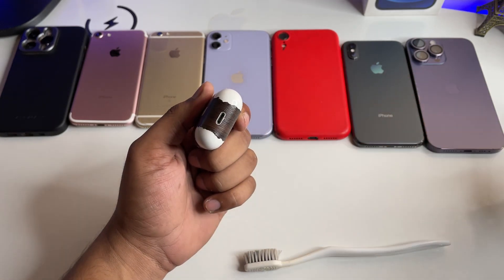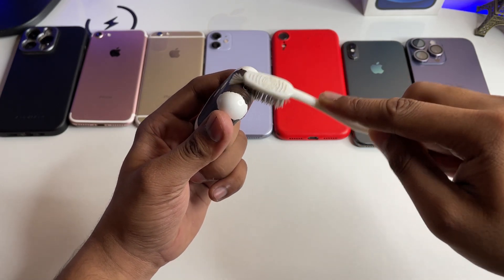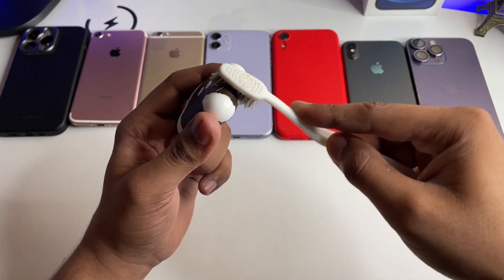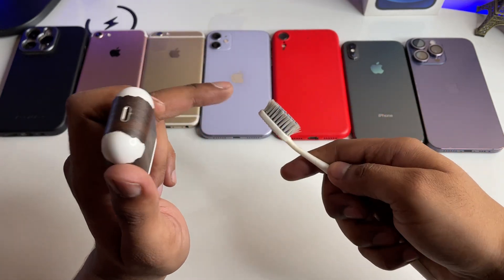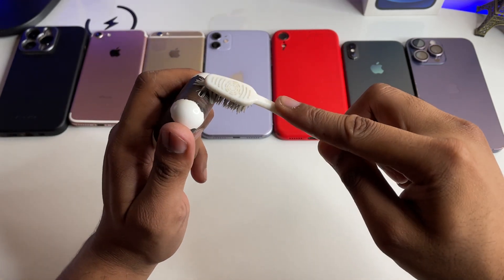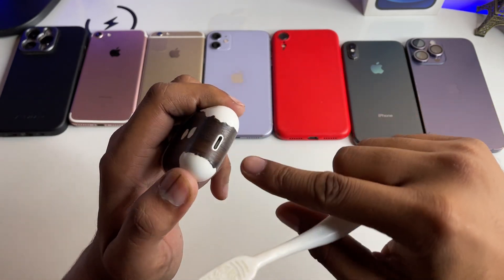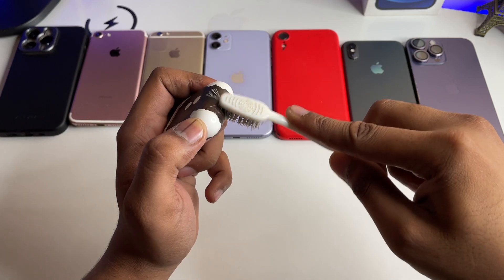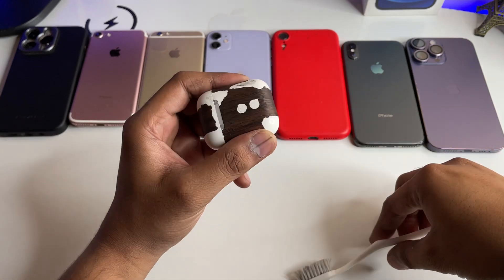My charging jack is now fully cleaned. Before, it was not charging due to some carbon buildup from heat and handling with wet hands. I cleaned it using acetone — you can also use petrol. Take your time, about two to three minutes, and you will see the golden contact points shining like new. Set your AirPods on charge and the issue should be fixed.